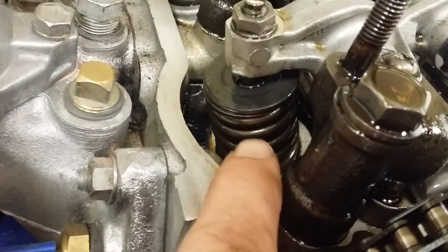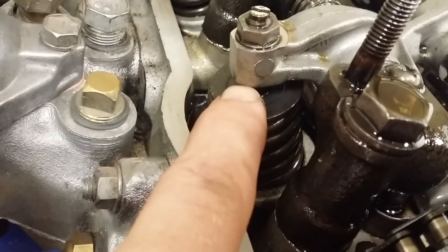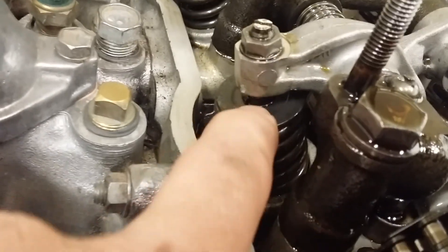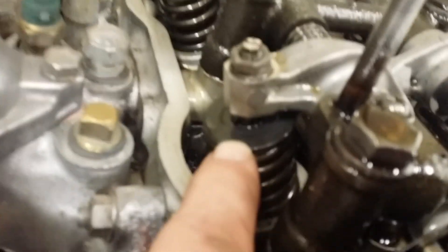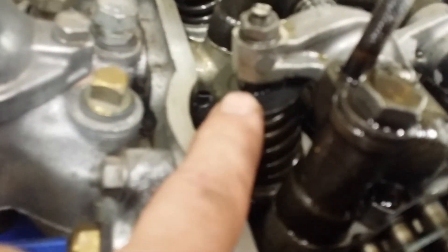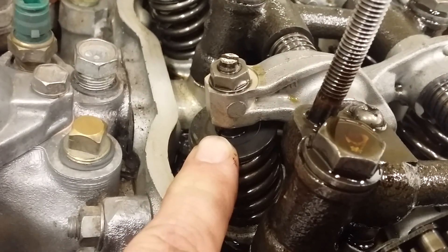The inside of that spring is a stem coming up from the valve, which is down in your combustion chamber in the head. This rocker tip is touching that. Well, you don't want it to touch initially, because what happens is this stuff expands and it'll get too tight — you'd wear out your valve train or break something. So what you have is a valve lash adjustment, a gap adjustment. Follow your manufacturer's recommendation, because everybody's got their own opinion on what that's supposed to be.